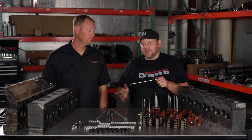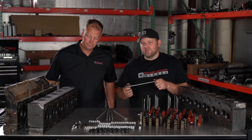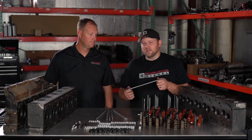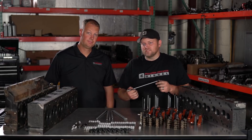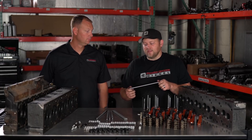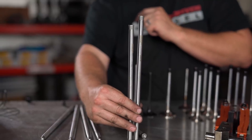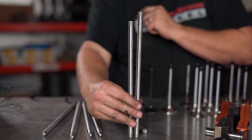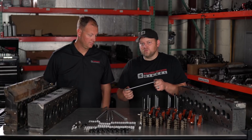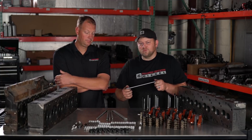The holes in the head aren't big enough to handle a 9/16ths pushrod, so we've got to ream out the pushrod holes through the Warhead if you want to go that big. But when you're at that top level of performance, there is room and meat in the head to make that happen. The pushrods we provide are the proper length to work with your valvetrain — whether you use factory rocker pedestals or the option Todd will talk about next.